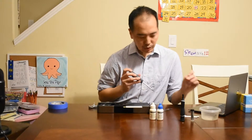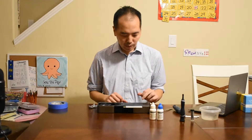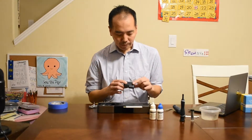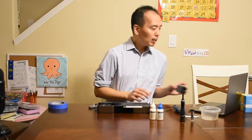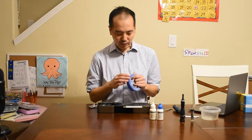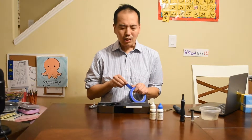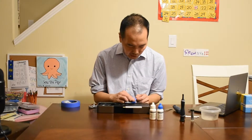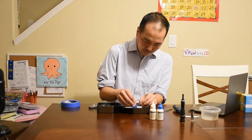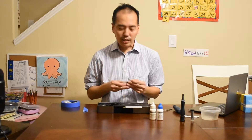It's not four screws. Now the next piece here are these little screw covers. People say you can take them off with tape; other people say you can take them off with magnets. Let's have a close-up — we have these little pieces: one, two, three, and four. I'm going to try tape for a couple and magnets for others. Apparently the original instructions — I think GamerNexus had a video about this — they said use tape, use glue, but glue gets in the cracks and causes problems. This painter's tape is not sticky enough, but I got one off with just painter's tape by pressing and pulling. I'm going to try a neodymium magnet to see if it really does pull off the others — this is much better than using glue and waiting for it to dry.